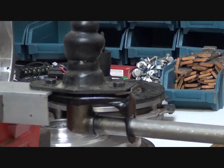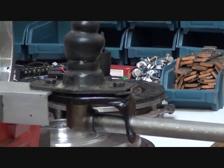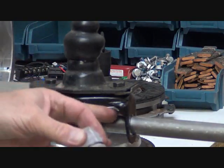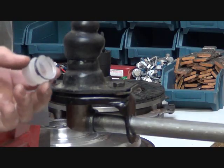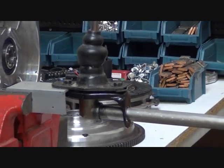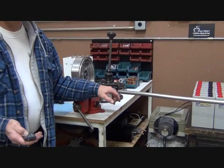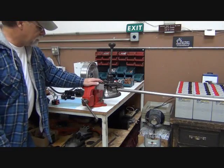So anyway, what that bushing does is it centers this in that, and so instead of metal against metal, you have metal against this. I'm not sure what these stock ones are made out of right in the moment, but you grease them up well. You grease up the rod real good, and that buys you a little bit of time. But like I said before, the bottom line is they're a time bomb. And so later on in this series, we're going to show you the way that we fix this problem, which is a permanent fix. Never again have to visit this problem.